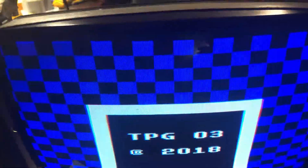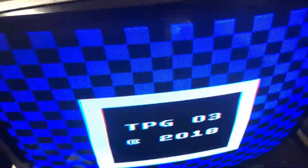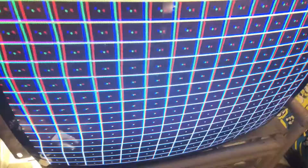Hey, this is Paul. This is a repair for Carl — the K7000, 25-inch, came to me dead. I put a new flyback and HOT on it, a new fuse, did caps on it already, and it's back up and running and looking good. It's been on my testing rig for several hours and no other problems have come up.